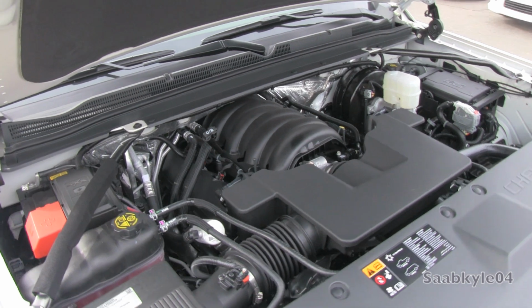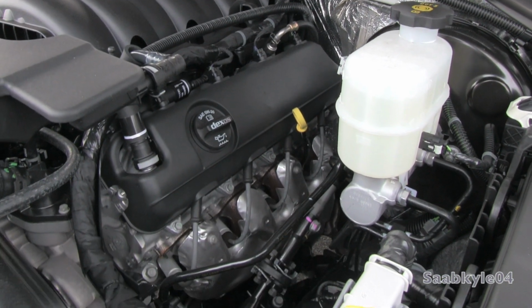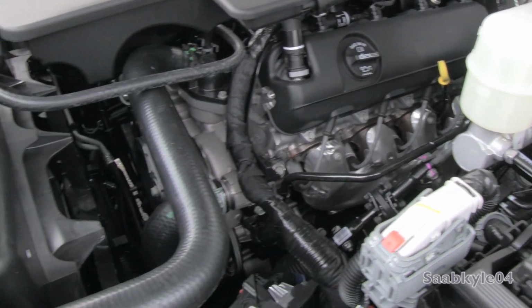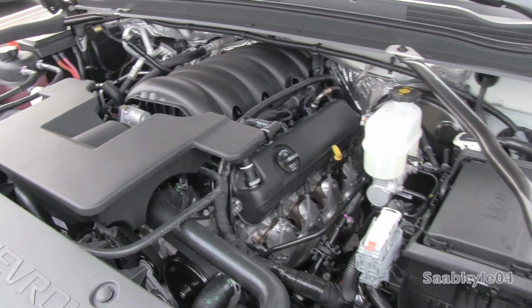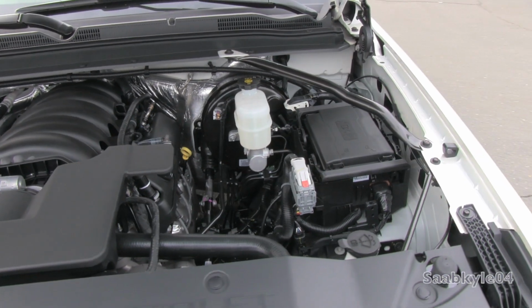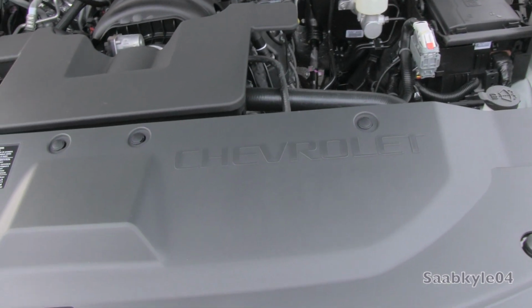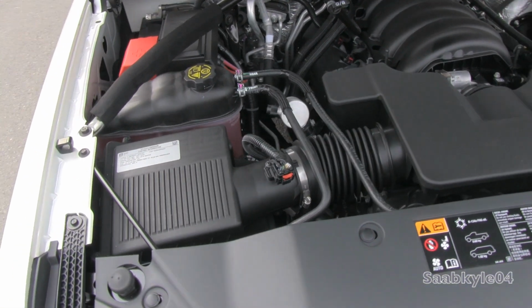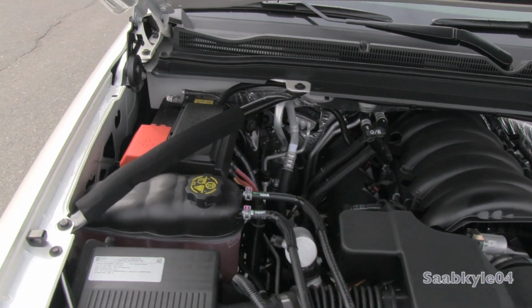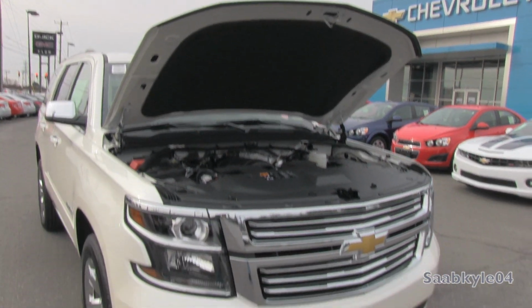The 5.3-liter V8 is currently the only one available in the Tahoe, while the V6 is only in the latest trucks, and the 6.2 is included with the Yukon Denali and future Cadillac Escalade. The new 5.3-liter shares its core structure with the outgoing 5.3, but has very little in common overall. It still features a pushrod 2-valve per cylinder design with an all-aluminum construction, but where it really makes the difference are three things, hence Ecotec 3. Variable valve timing, direct injection, and cylinder deactivation.